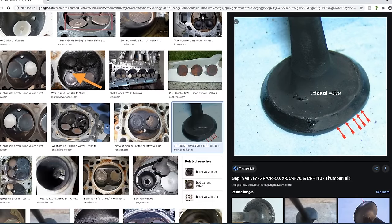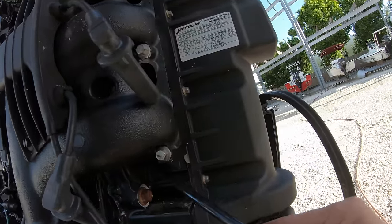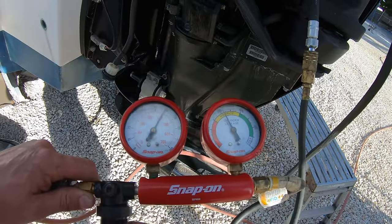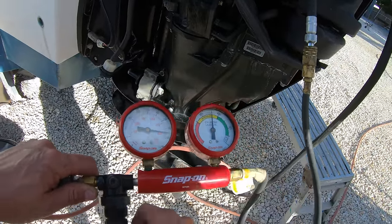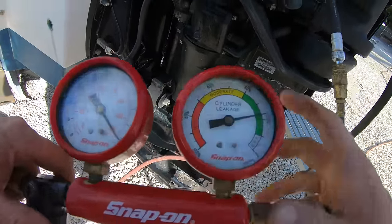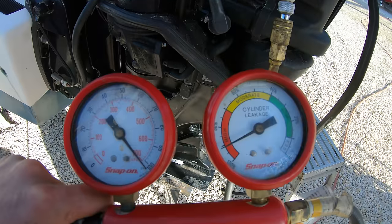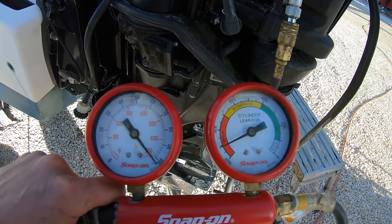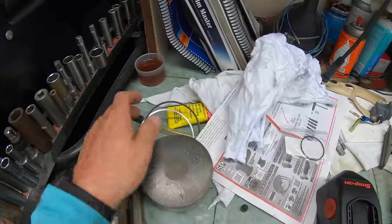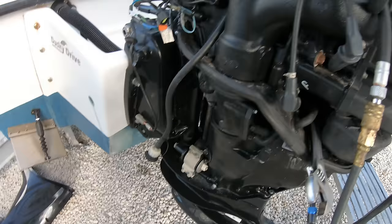If the readings won't come back up, then the next testing procedure that would need to be done is what is called a leak down test. This test is where you put the piston up at that top dead center position on the compression stroke, then apply air pressure from a leak down tester to see what percentage of the air leaks out of the cylinder to help determine what is going on with the engine. You can usually hear whether the air is going out of the exhaust valve, or you can take the oil fill cap off or pull the dipstick out and feel the air coming from the crankcase, telling you that the piston rings are where the leak is. Or you can hear it coming from the throttle plates or air intake, telling you that the intake valves are leaking — you'll usually hear a hissing sound or feel the air.